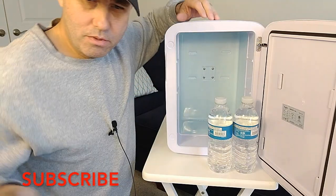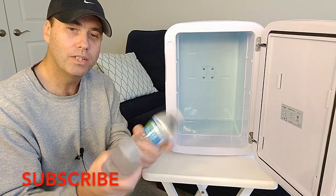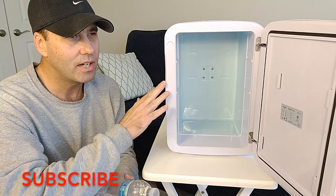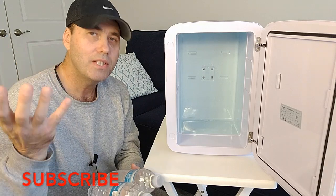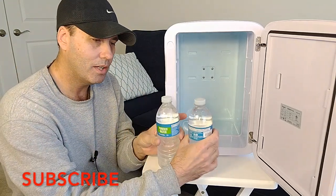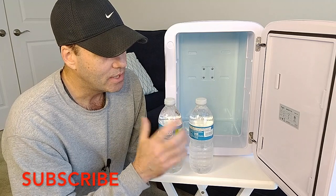Let me get the water out of the way. These are the waters that I put in there. Actually, I was testing the cool on them, so these are cold. But here's the thing. This is supposed to get 35 to 40 degrees below ambient temperature. So in other words, it's 76 in here, and I had these plugged in for a full day, and these are at 44 degrees. So that's what it got down to.